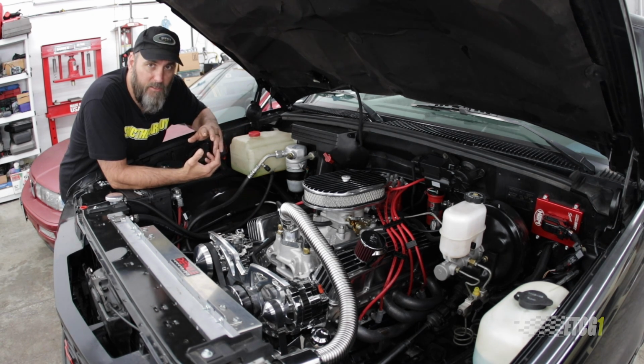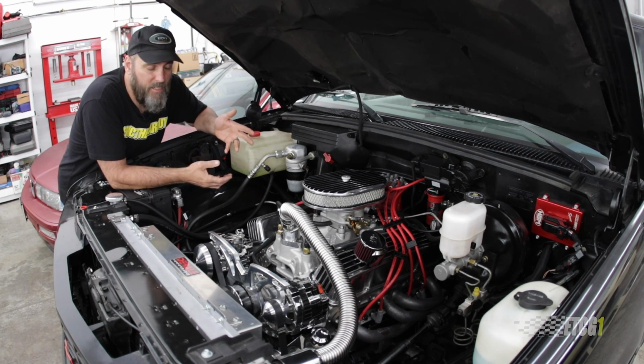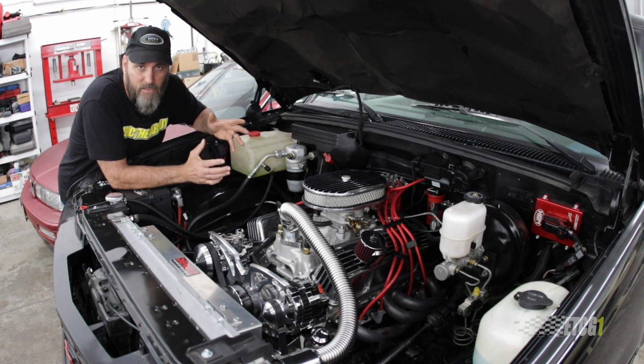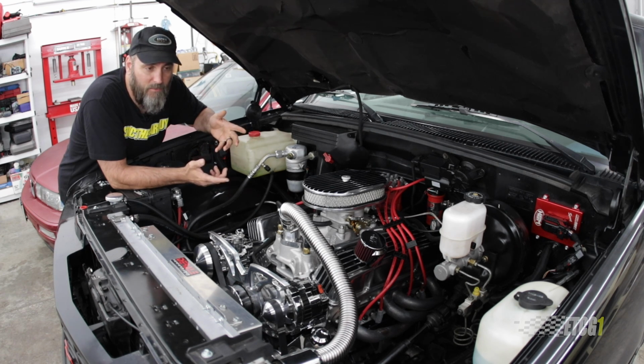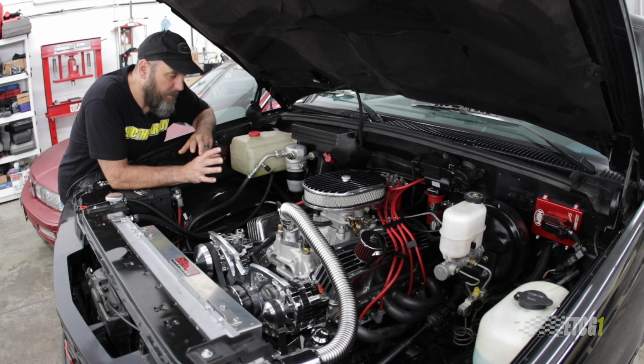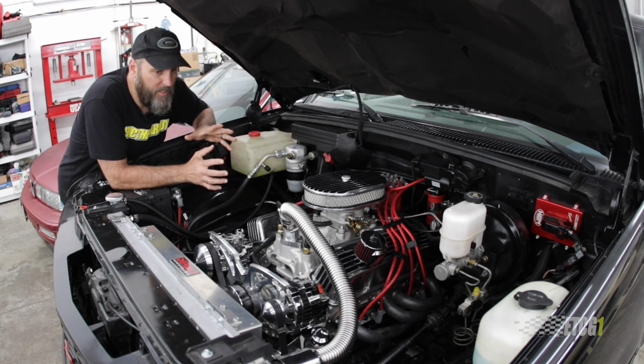I hope it doesn't come down to me having to measure things, but that's my intention. My intention is to pull the engine and measure those cylinders and find out, well, first inspect the piston on number 7, see if I've got broken rings or something of that nature, and then I need to find the real root of the problem. And I think once I do, this will be a very smooth, nice running engine.